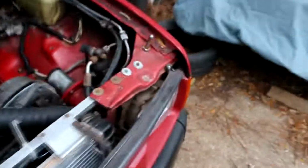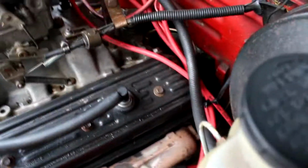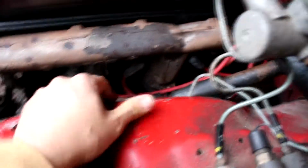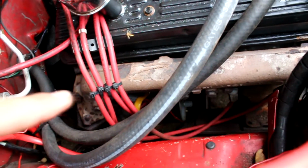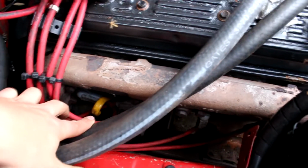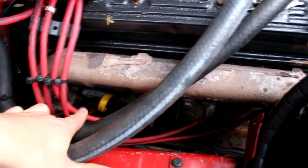So yeah, it all works. And also the dipstick issue that we were having, because I can show you now why we couldn't do it. The stock dipstick would come out of the oil pan down there and basically go into where the steering column and the tub for the tire are. And the stock hole is right behind that downpipe, which you can't get around. So that was a no-go, so we had to relocate it, which we did. And boy, let me tell you, the fitment on this, do you see that little flash of yellow right there? That's our dipstick. It is between two of the header pipes on the manifold and two of the spark plugs, like dead set between them.